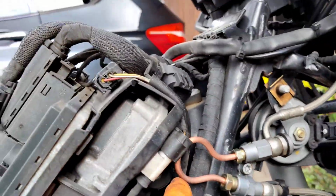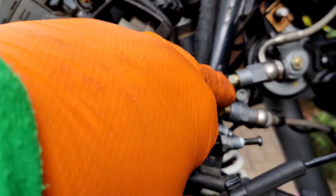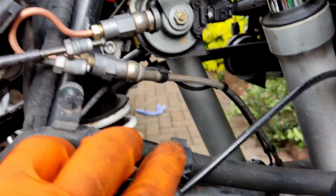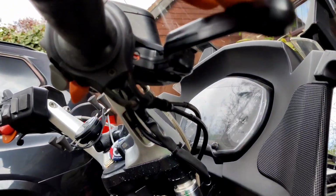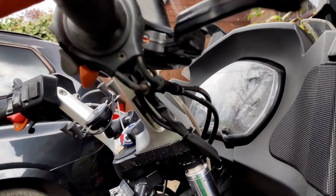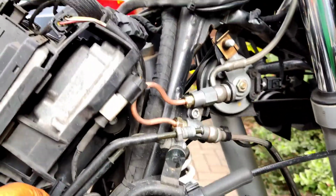Okay, that's the front link done. Linking the master cylinder hose to the hose that goes down to the brake calipers, and I've bled that, and there's quite a bit of pressure on the lever, but I'll leave it overnight pulled in with the cable tie around it. That'll get all the bubbles to the top. Right, so that's the front. Now the back lever